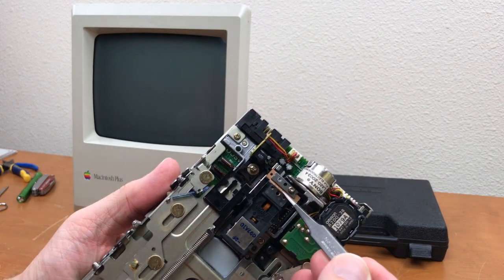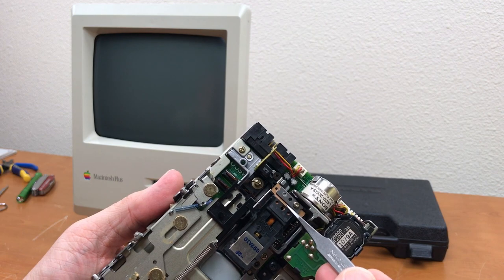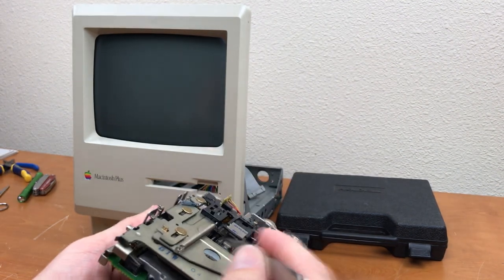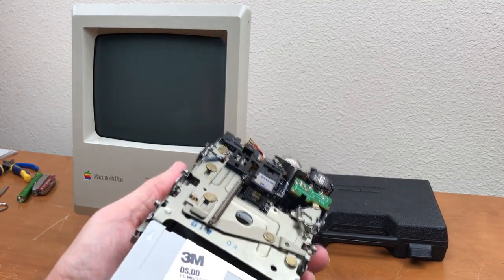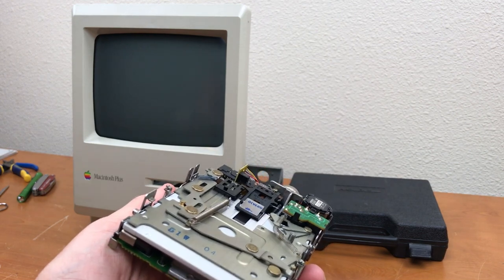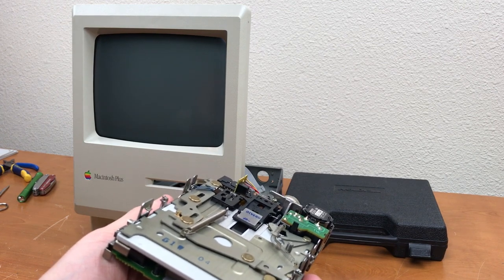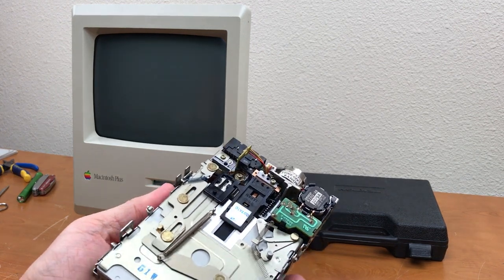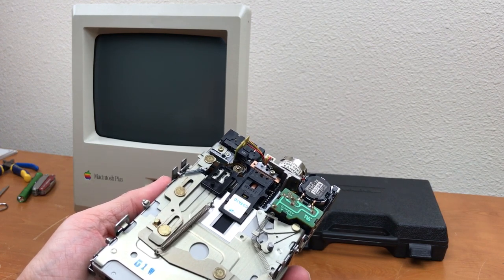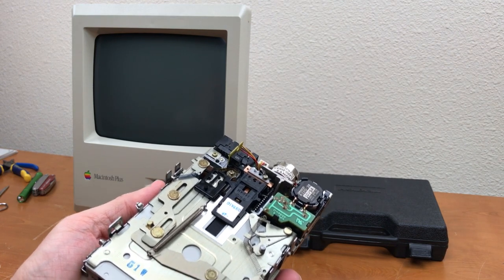This piece of copper right here that holds the drive head in place is soft. And when you lift up on this, that copper bends, and then there's no tension holding the two heads together. I fixed it, but if you put a disc in and the head doesn't drop down, that's what you've done. It took some effort to fix it. I did it off camera, so I can't show you how, but I'll put a link in the description to another YouTube video that showed me how to fix it.